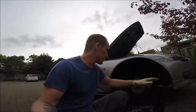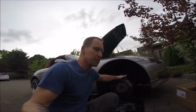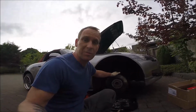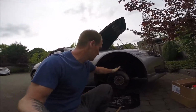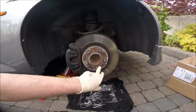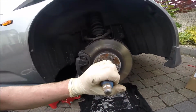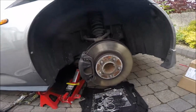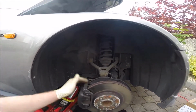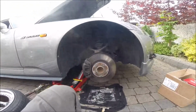So the next step is to test the brake disc ventilation. So we have to remove it and replace the disc. The first step, of course, is to remove the wheel. Next we have to open the two screws. That will probably be one of the difficult parts. We'll see how this works. And next remove the full caliper, disc out. I'll just show you how to do this. Alright.